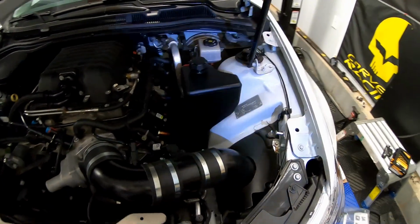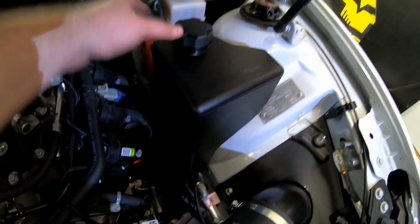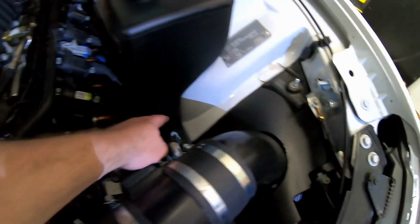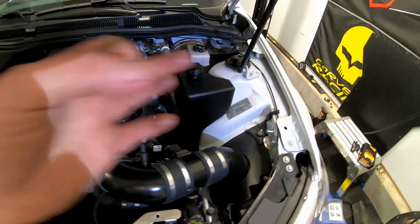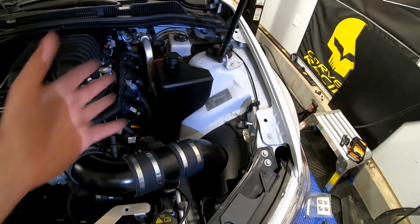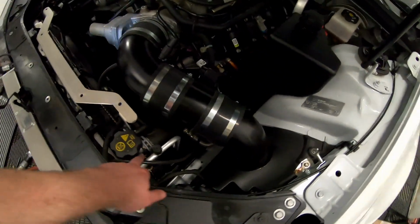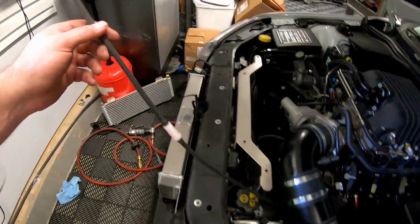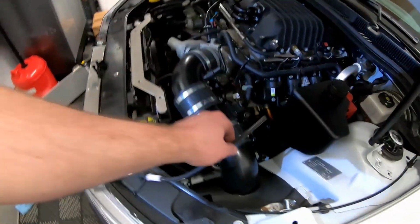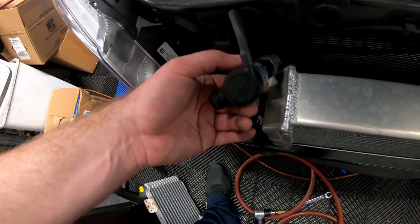We have the finished tank installed. What we did was we slid the stud mount inside the tank over the stud that we had put in. I also fished the side mount going into the fender. I put that into the grommet that's in the fender, pushed that in, and we're good to go. What we need to do now is run the tube from the bottom over to the factory pump. So this is what they give you for the Camaro. But what we need to figure out is, if you look over here, this is the factory pump that I have left in place.